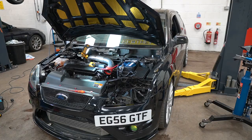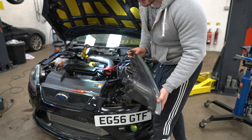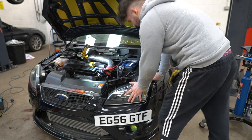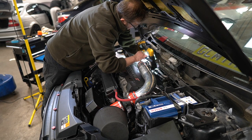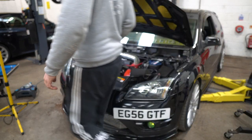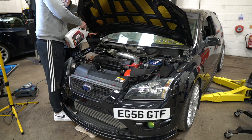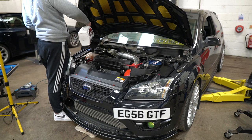The second to last pipe has been installed. Now putting the headlight back in — I always forget to plug it in, but I plugged it in this time. What specific skills would you say you need to do that? I'd say a level 20 finger-blasting wizard could do it — I think I'm like level 16 and it's kicking my ass. On average the ST takes about 6.7 litres of coolant. Obviously it's not completely drained — we haven't taken everything apart — so I'll assume there's a fair amount still in there. We'll drag it up to see if it's dripping, and then put this in and let it go.